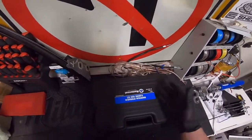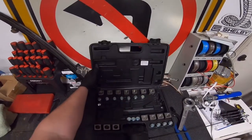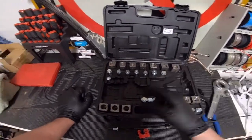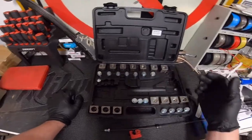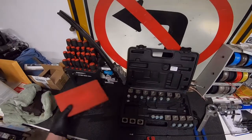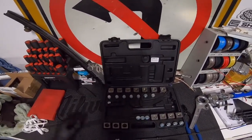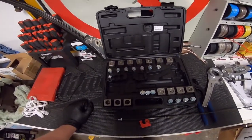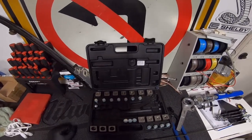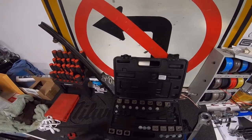It's a Master Cool universal hydraulic flaring tool kit. It comes with dies that'll do inverted flares, bubble flares, and push-connect fittings. It definitely beats using the old tool and saves you a lot of time running around trying to find fittings to adapt your brake lines — fewer adapters means fewer places for leaks. This really is the way to go. So, this is a 3/16-inch line here, so we're going to grab our 3/16-inch die.